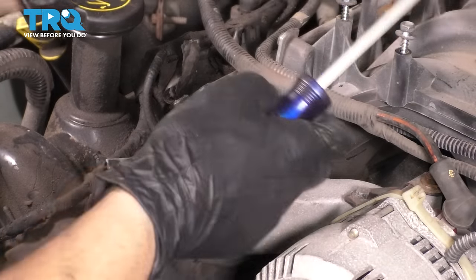Now, when you install this seal, you want to press on the outer lip here where it has a metal sleeve going around. You don't want to press on the inside or on this lip here or even in here, because it will damage the seal. And even when you do press on the outer lip, you don't just press on one side, because you'll end up with something like this, where it's all deformed and damaged. You need a cup, preferably. I have this out of my ball joint press, and I cleaned it all up, and it actually fits perfectly around this seal. It is the exact same diameter as the seal, which is what I'm looking for. And with this, I'm able to press this down and in perfectly flat and evenly around, and it will get a nice tight seal in there. With your seal nice and flat, go ahead and tap it in.